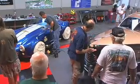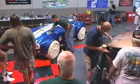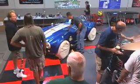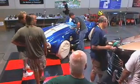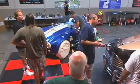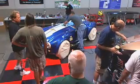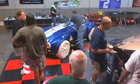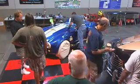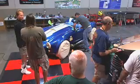With something like this custom built car, you don't know who sanded and buffed it before you got it. See how much paint you've got left. Now this is a classic that's been repainted, but it's also had a full wet sand, cut and buff, so we're still being real careful with both of them. We have a philosophy here at Autogeek to use the least aggressive product to get the job done, because that leaves the most paint on the car to last over its service life.